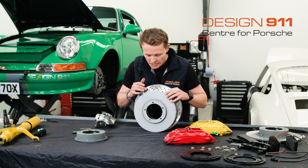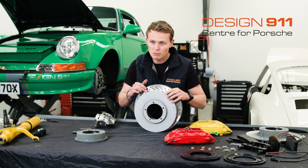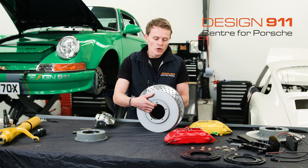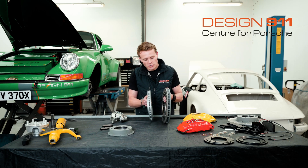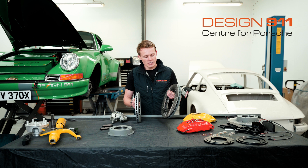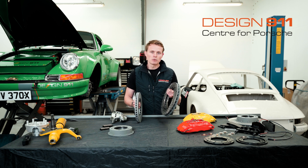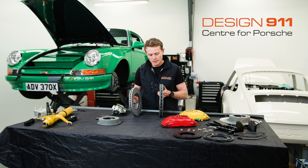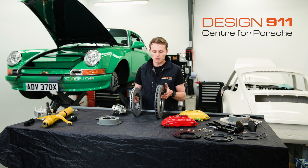This original brake disc is 282mm compared to a 322mm brake disc. By using a much bigger brake disc, your braking system has much more mechanical advantage — your braking system can generate much more torque. That's the first performance upgrade.